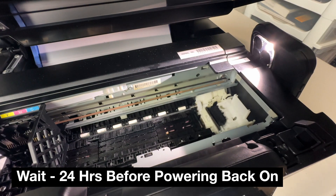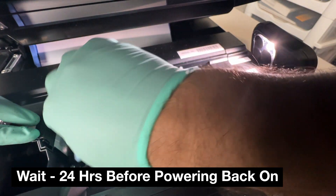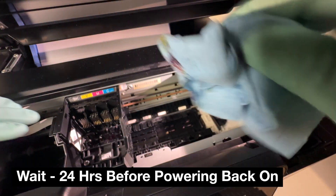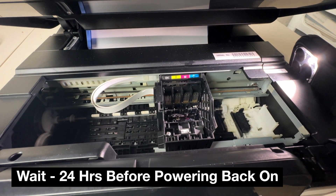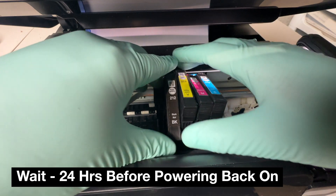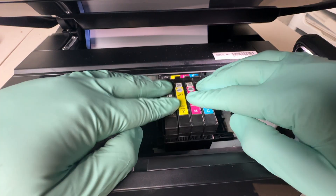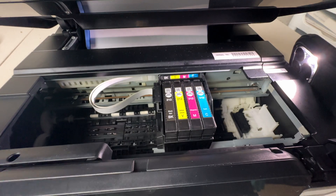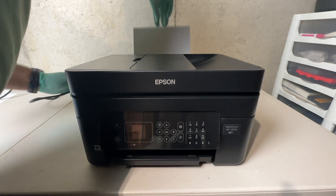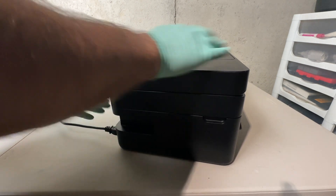Once the towel is totally soaked, remove it and dry the area. If you're continuing your cleaning, put another paper towel down — use as many as you need. Don't be shy with the cleaning fluid on all of the colors; it's better to do a total flush the first time. Then install your brand new ink cartridges — you don't want to install the old ones because low ink in the cartridges is what causes this problem. It can be third-party ink cartridges, which is usually what I refer you to because it's a lot less expensive. Buy a couple of boxes because this next part is going to consume a lot of ink as well.